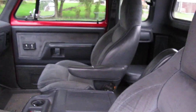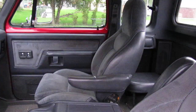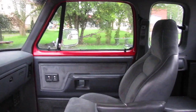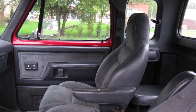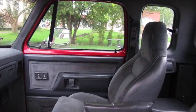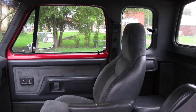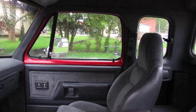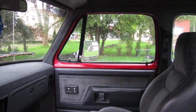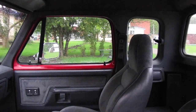When he had it in BC he used it as a camper — had one of those box campers chained down. I think he really did take care of it. The only reason the rust happened — and I do believe this, I've watched videos on it — is that rubber membrane on the frame. I think it just got in behind, trapped moisture, and with salt in there it just rusted the living heck out of things.